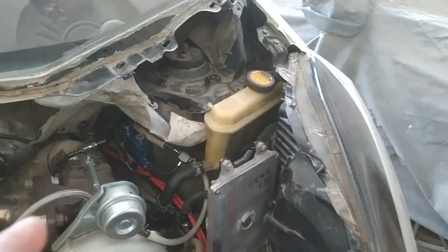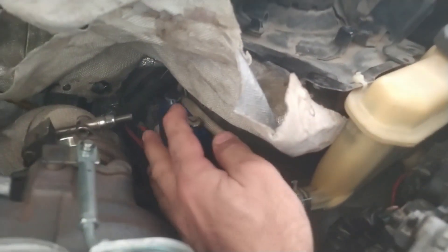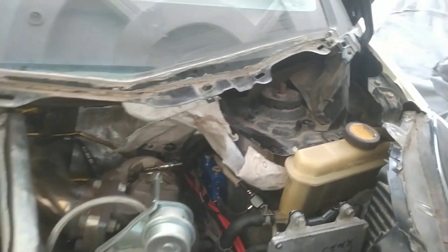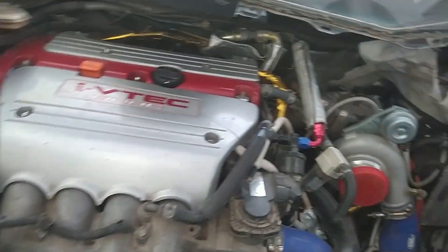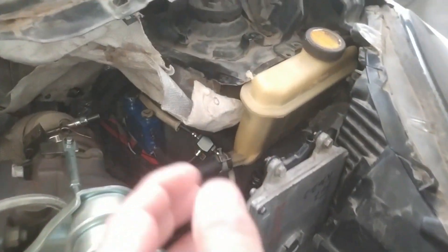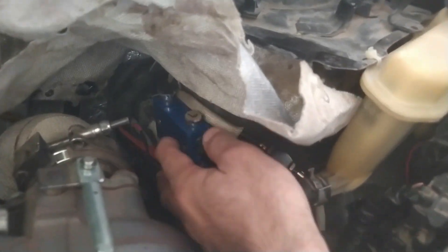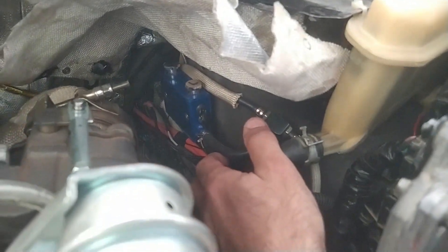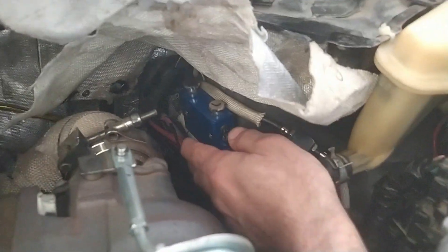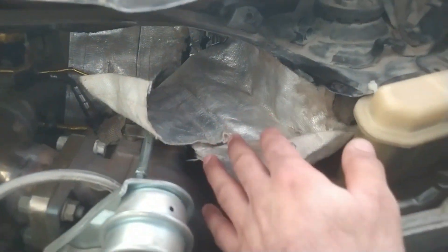Another very important thing: this is not waterproof or rust proof. Some people install it in the engine bay and cover it with plastic covering. But this needs air to bleed the boost — if you seal it airtight it will not work. You need to put it somewhere away from water and cover it, but don't airtight it.